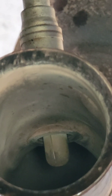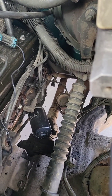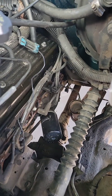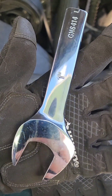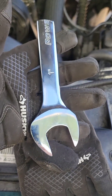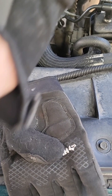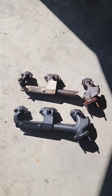Successfully got the EGR off, and the back half of the manifold. The oxygen sensor looks a little ugly but I'm not going to deal with it right now — I have a brand new set of O2 sensors and a brand new catalytic pair going in, so I'll deal with those later on. The EGR hose was a bit of a pain. What I ended up doing was taking a one-inch Power Torque GM6414 — probably not a lifetime warranty anymore — got that to where it fit on there, put a big breaker bar, pushed against the end, and shoved it loose. Then I grabbed my big blacksmith's pliers and finished it off with those. Pretty easy. Got it off, and here's what we've got left.